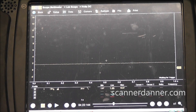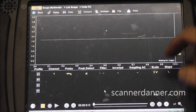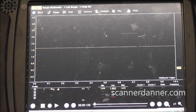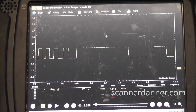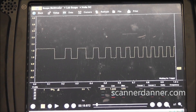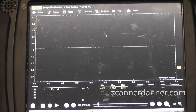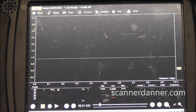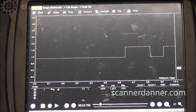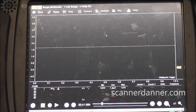This is my other wire - this is going to be the signal wire. I'm going to change my voltage scale down to five volts. What we're looking at right now is a 1.6 volt flat line. Now I'm going to turn the wheel - as I move the wheel you can see we have a square wave of a specific frequency. Very tough to move this front wheel with it being a front wheel drive car, but you can see the on-off square waves. The tool said it was one and a half to two volts; we're actually at 1.6 on the peak and 0.8 in the valley. This left front is a known good sensor we can compare to when testing a bad one.